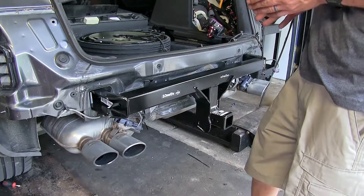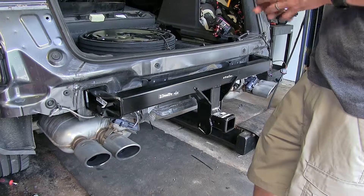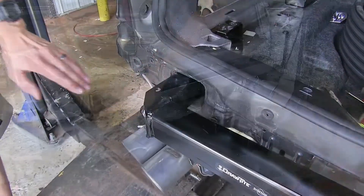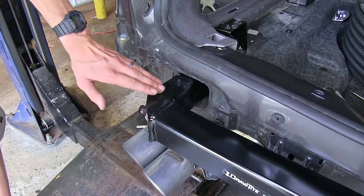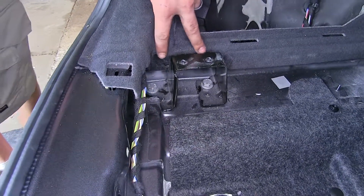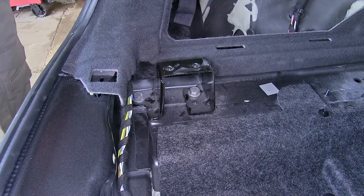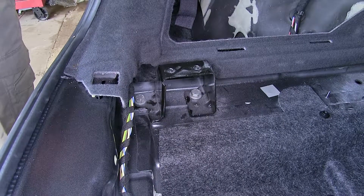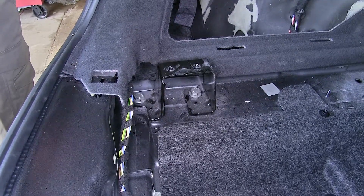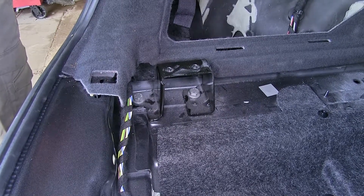With our fascia off, this is what our hitch looks like installed. While this may look like a very involved install, it's really not that bad. The hitch simply slides into the channel in the frame rail where the factory bumper beam was, and is secured with the factory bumper beam bolts. This is a lot easier than other options for the SQ5, many of which require drilling, trimming, and cutting of the heat shield and lowering the exhaust. This is just a direct replacement for the factory bumper beam.